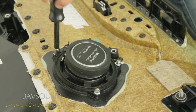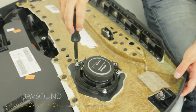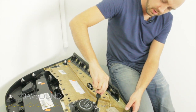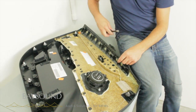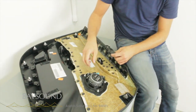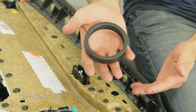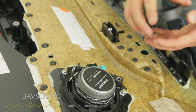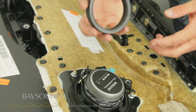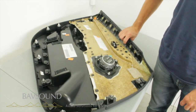With regards to putting this back on — that whole star pattern thing — get one started, get it kind of snug, and just work your way around. Don't just wrench one down and then go do another one. Just give everybody a chance to come to the party. So snugged up, we've got our sound deadening applied. At this point we're going to pop off our boot from the ferrite motor structure — this has no acoustical bearing whatsoever, so it's just for aesthetic. Some of the newer ones might not have this because we're trying to minimize waste. So just take it off — use it as a koozie, play ring toss with it. Let's move back over to the car and get rocking and rolling.